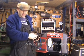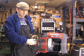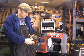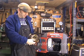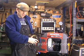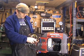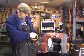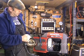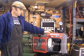This is a flywheel with the stator still in the middle, because they stick in there like hell with the magnets. We did have some EU-10Is earlier in the year where the cold weather had got to them and made the flywheel contract beyond the ability of the glue that holds the magnets on, so all the magnets had come off and stuck themselves onto the stator. Usually though, if you pull it over — just give it a jerk and pull it over slowly — if you hear any scraping going on, it can be a clue that you've got a problem with the flywheel. Also, when you're pulling it over, if it seems to be fantastically hard to pull over, obviously that could indicate an engine problem, but it could also indicate a problem with the inverter, or possibly the stator, but usually the inverter pack.